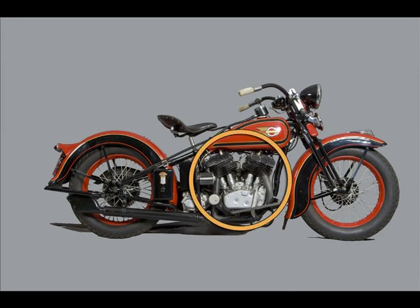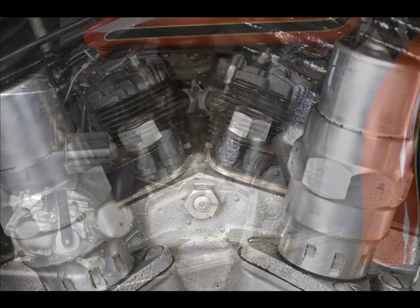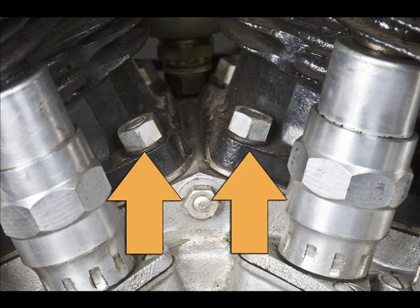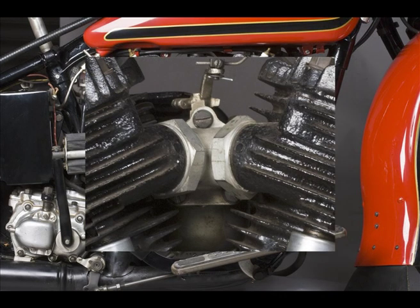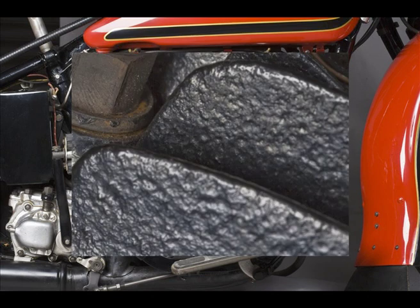Now we're looking at the engine. It's a stroker engine for 1936 because Harley added an extra 1/8 inch each way by moving the crank pin towards the edge of the flywheels, taking it up from 74 to 80 cubic inches. So we see stroker plates underneath the cylinders, and this means shorter nuts to hold the cylinders down to the base. They're one-year only cylinders for 1936 with 3 fins near the manifold, and these are in pretty good condition. There are no reproductions available, so I let a little bit of corrosion go if there are no broken fins.